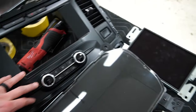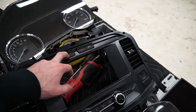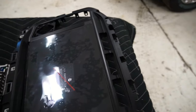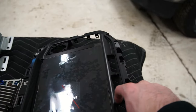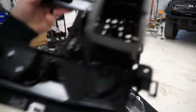Obviously we don't need the old controls, so we'll leave that. This one has two slots for the buttons, and this one has three. We're going to swap these two over, but there'll still be a missing slot, and you can either get the button that's supposed to go in there or get an aftermarket button and install your own lights to it. Just know that there will be an empty slot because this one has three slots instead of just two. It's fairly simple — it's just clips on the backside that we need to get out and then snap into there.